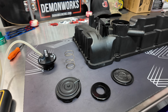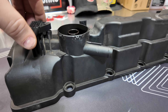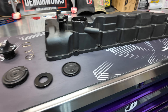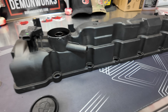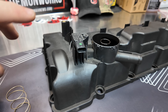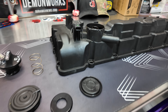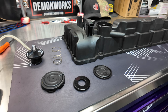Using the manometer gives a much more precise number, and mine is within specs — reading just over 0.1 psi, still considered 0.1 psi when you factor in how non-precise this sensor is. I want to reinforce that popping off the oil cap, while it may look bad, is not very informative — this sensor is extremely sensitive to anything above 0.1 psi when driving or if it's frozen, and it's going to set the check engine light almost immediately.